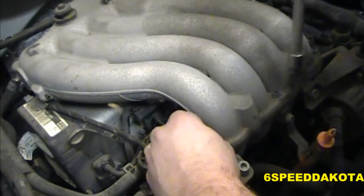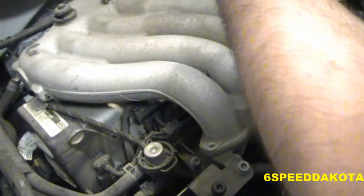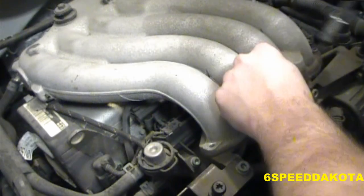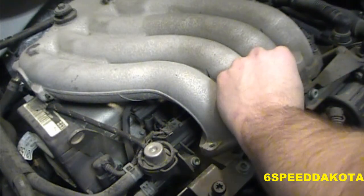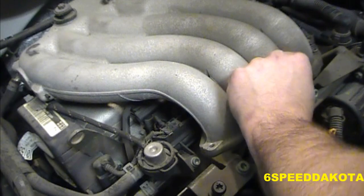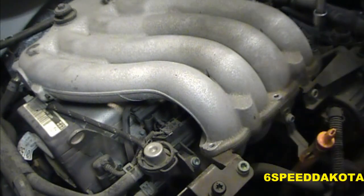Now, remember to be careful not to get anything into the throttle or into the mass airflow sensor. Don't stick your fingers near the throttle, especially when the key is on and that thing's not disconnected. And I don't know how the hell to disconnect these stupid connectors. The one that I unplugged looked like it was already broken, because it doesn't have the little clip inside it. But like I said, the less disconnecting I do, the better, because there's about a bazillion vacuum lines in this engine.